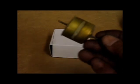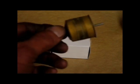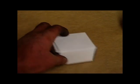When I was taking the carburetors apart, I noticed that the floats were cracked. I don't know if you can see the little cracks around the edge right here, but I was very surprised that on both floats the brass on them cracked. And when the float gets a crack like that, it turns into a sink. So we've got some new ones here. Expensive stuff, but the bike's not going to run unless it's on there.